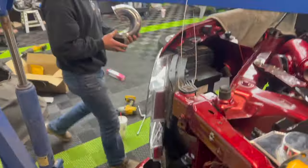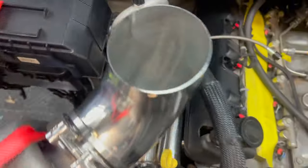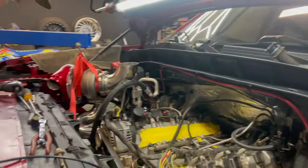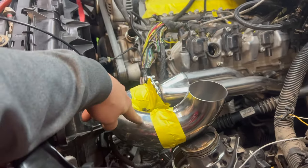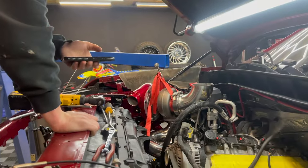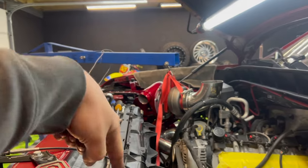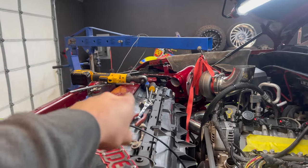We got it all tacked up. The turbo is just mounted with one bolt over there — like I said, it's real tight over here. We're going to put some heat stuff all over that but that's where the turbo is going to mount. We're going to mirror it over here. This is going to be insane — it's all coming together. Pretty much just a triple-90 setup, so pretty simple, honestly not a whole lot of pipe. The exhaust is four-inch, so big exhaust coming out the hood, and we're going to route the intercooler piping up and right here on top of the radiator.